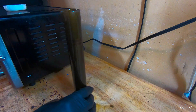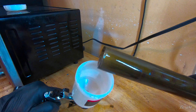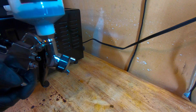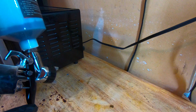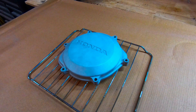Get your paint gun, go ahead and fill it up. You'll want to spray this between 20 to 25 psi. Make sure you have your regulator adjusted. You'll want to shoot your more difficult edges first and then cover everything else.